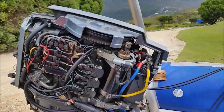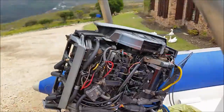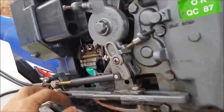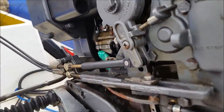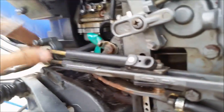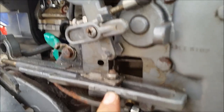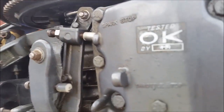It's very dangerous working with these things. Even with the battery hooked up, you could short that out and cut a finger off. The last thing you want to do is attach your cable — you actually want to remove your throttle cable, because when you're doing the Max Advance, this has to be all the way against the top of the motor and you cannot have it in gear. It's got to be in neutral. So you've got to disconnect your throttle cable, press that all the way to the top, and that is where you're going to be setting your Max Spark Advance.